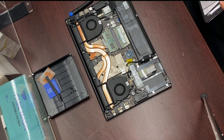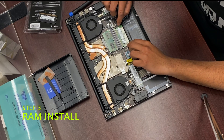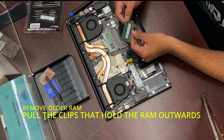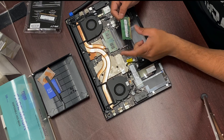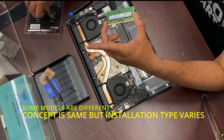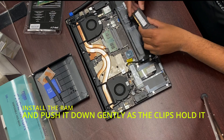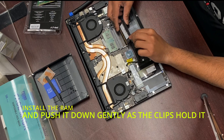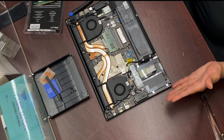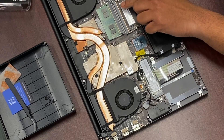Let's open up the RAM and keep it separately. When I'm trying to install, there are two slots. Why did I install in the bottom one and not the top one? Well, there's no order — you just have to make sure that those clips you pull outwards and your RAM comes out. I was a little bit concerned to see a Samsung RAM installed in a Razer laptop. A lot of my friends actually have HyperX that comes pre-built, but it's okay. You just push that back in, the clip falls back, and your RAM installation is done. Just make sure you are gentle with the process.